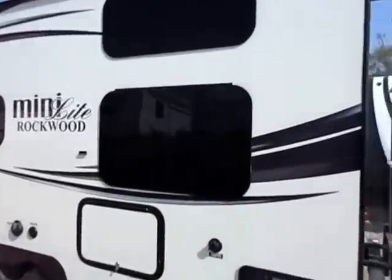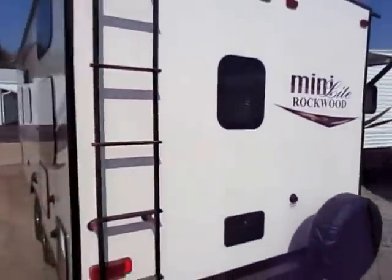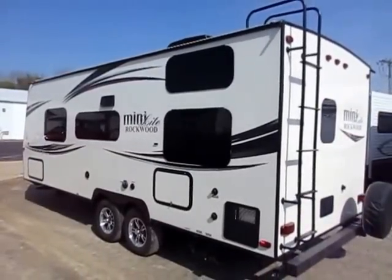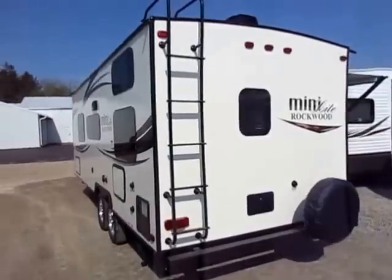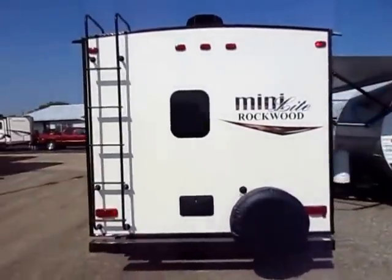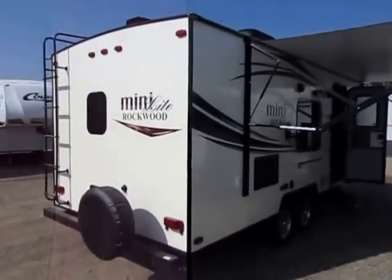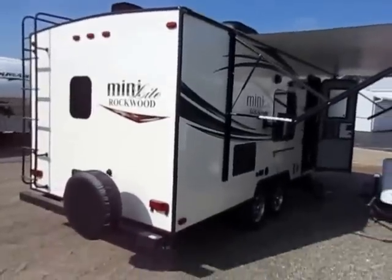Helping combat those stresses even further is the fact that this is fully six-sided laminated. Most lightweight trailers only have laminated sidewalls, but on a Rockwood, it is fully vacuum laminated, which is the strongest, longest-lasting process out there. There's nothing wrong with pinch rolling — I have pinch rolled products that are extremely reliable — but over time, the vacuum lamination process has been shown to last longer with fewer instances of failure.